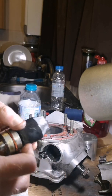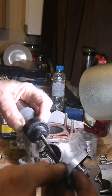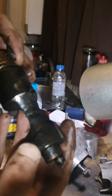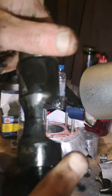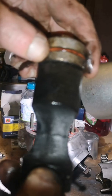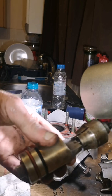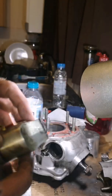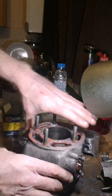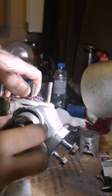Have a look at this power valve. I can pick it up - it hasn't had the dowels in so it could have been moving. That's what could have hit the piston. Anyway, we'll put this power valve in - just slide this off in first. It goes on that side, just pushes in. Then you've got your two dowels - just want to show them line up.